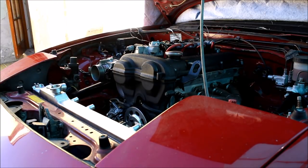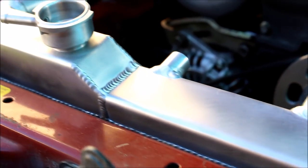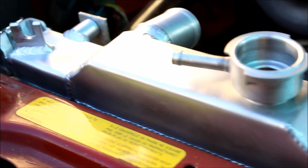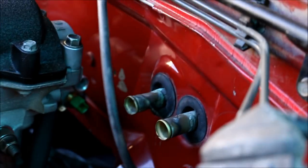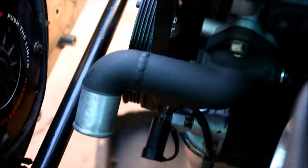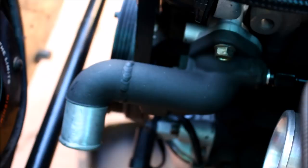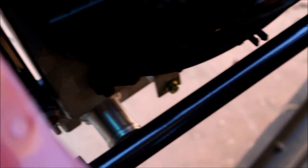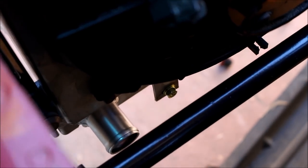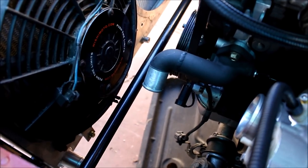Drops in just like stock. Sweet. I'll start with the bottom. Now I am keeping my heater core because I'm kind of a baby and I need my heater — I mean, it's to cool the car down at the track. Anyways, I don't have a provision for a heater core line off of my modified inlet housing, and it's got to be connected down there to the bottom of the radiator factory location. So I have to run a bit of a custom line and I'll show you how I'm going to do it.